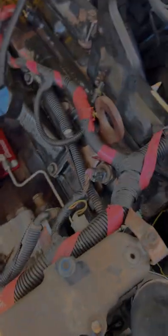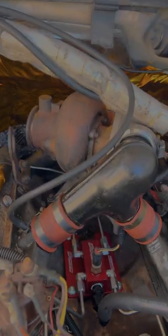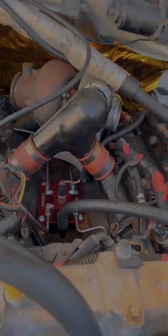Fuel lines are all installed. Now to get the feed line up to it. Time to hook the pump up and check for leaks. Up pipes are in — that was a fun job doing the one-piece up pipe. Looks good and it passed the leak test. Now it's time for lunch. It's back together kind of — the turbo was a pain but a friend Brad showed up and helped. Turbo's back in, just have to put the hood stack back in and put the front of the motor back together and we'll be ready to start it.